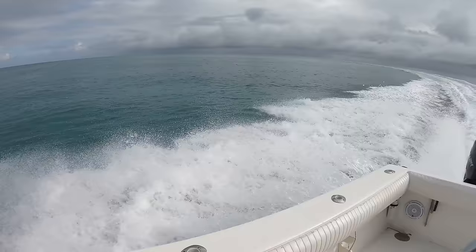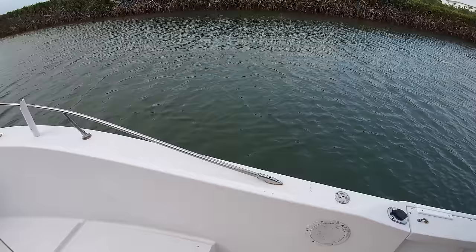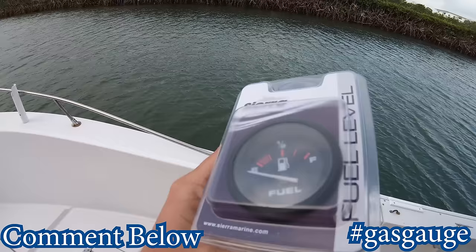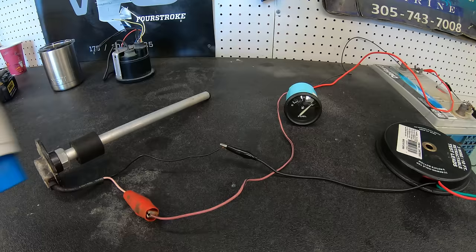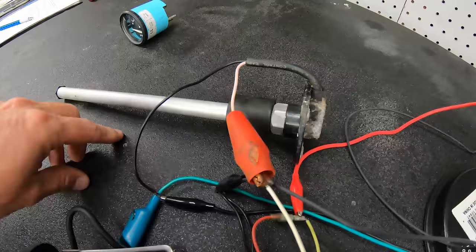Before we go over those changes, hit that subscribe button and get the bell on for all the great information. Let us know if you've ever ran out of fuel in your boat in the comment section below. Include a hashtag gas gauge for your chance to win the fuel gauge. When it comes to different manufacturers, the basic difference is that instead of having power and ground and a gauge in the system, the system will only use the sender, the ground going to it, and then the pink sending wire that will go from the sender to the white or pink wire on the gauge depending on what brand you have.